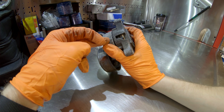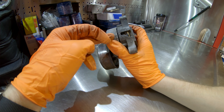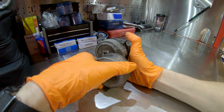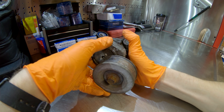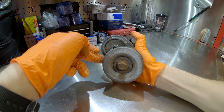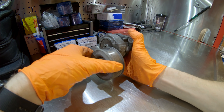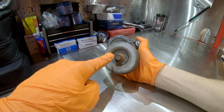The big issue with the auto tensioners is the spring — with time it wears and no longer exerts the amount of pressure on the belt that is needed. It can also start jumping with engine load; as the spring weakens it can cause the whole assembly to jump around and rattle and make knocking noises.